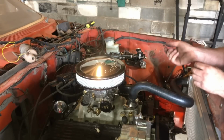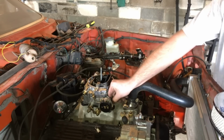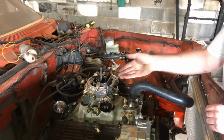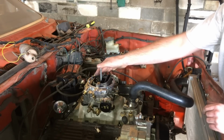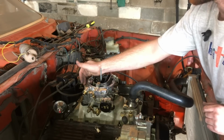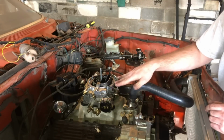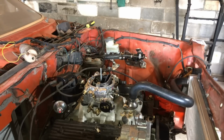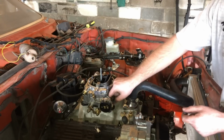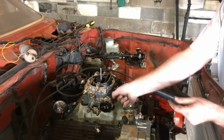I picked this one up from a swap meet because it was dirt cheap and it fits really good with this really short V6. You can run a Holley or just your typical 4150 style carburetor on these. If you have a small cap distributor, you could probably run a Holley. If you have an HEI to run a Holley, you're probably going to have to put a really tall spacer. Got some lock washers. These are all used ones, and it looks like I've got 2 shiny ones and 2 rusty ones. So we'll put the shiny ones up front.